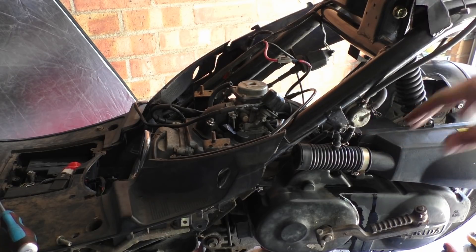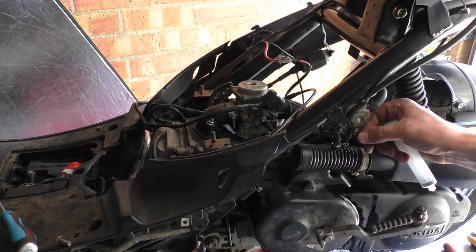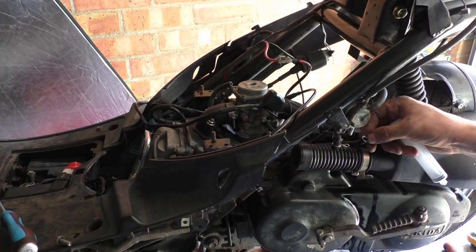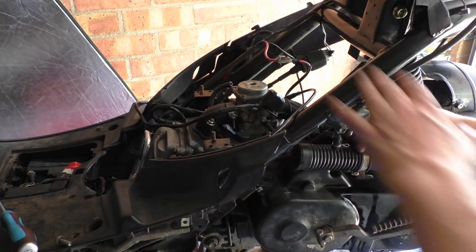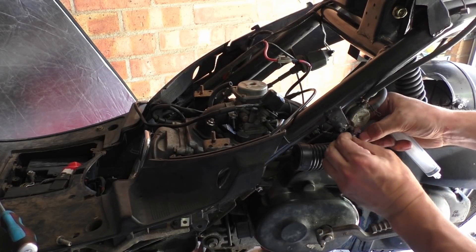The reason why it goes back to the tank is any vapours that come out of here end up going back into the tank instead of venting out. And then you'll have the 'out' here. But the problem is when you open it you'll notice there's nothing going on — this is if you've taken the thing apart and drained your carbs or there's some problem with your carbs. You'll notice there's no fuel.